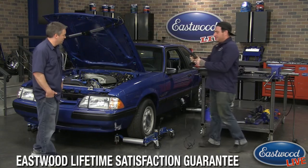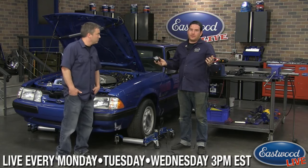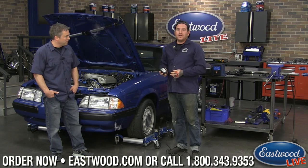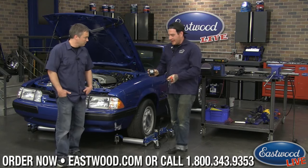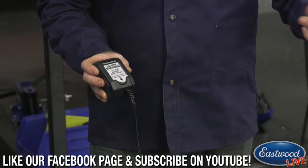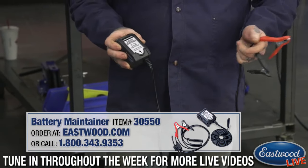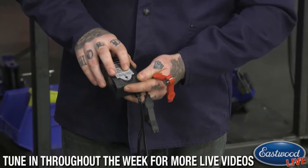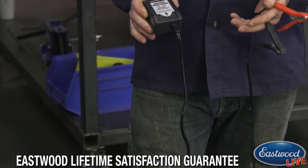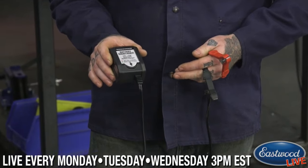While we're on the Mustang, it's in storage on wheel dollies and doesn't get driven a lot, so we have a battery maintainer. If you have a lot of vehicles in storage, or if you're in a part of the world where you don't drive your classic car in winter, you need this. This one actually charges as well as maintains. I used one recently - a car's battery was low, I plugged this in for a few hours, it started right up. It has a light that blinks when charging, and when it goes under 12.8 volts it goes back to charging mode - it bounces back and forth using a self-sensing microprocessor.